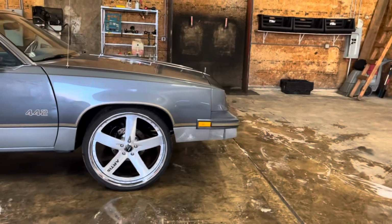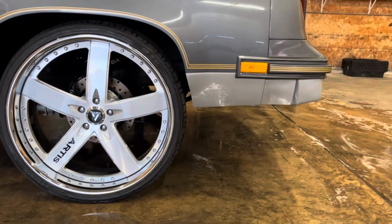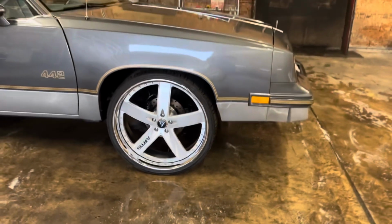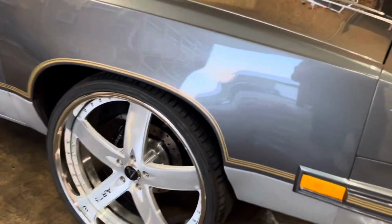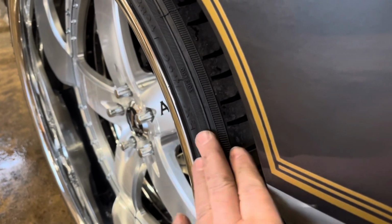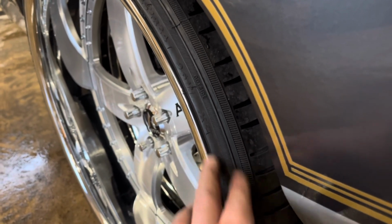Trim the fenders that little bit, which you can see. It doesn't look all gaudy like it's hacked off, too much forward. This tire's a fatter tire. Like I said, that's what I was saying on the rims. When you look at that tire, it's the same tire as the back. The front rim's a little skinnier, so it's squared up. Then if you look at the back, you can see that the tire is in a little more because the rim is fatter, so it stretches it.